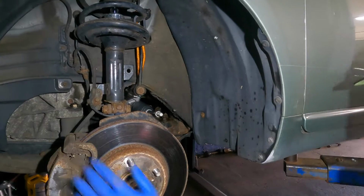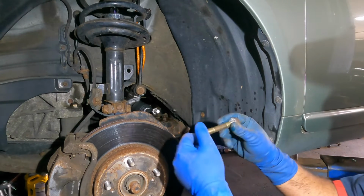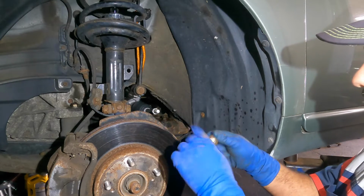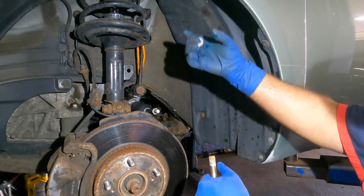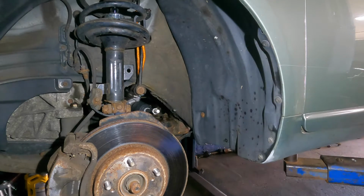Okay, there's a bolt on your left. Put that baby in. This is the bolt, so the two main bolts, we're gonna put them in and lock everything back up. The center of the steering yoke has to go in, and lock up the 12mm bolt. I'll show you guys once it's all completed.